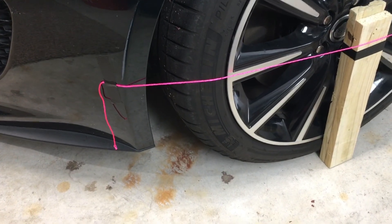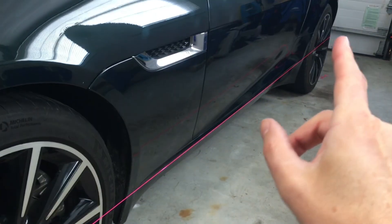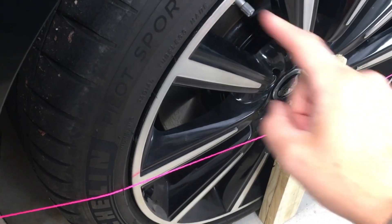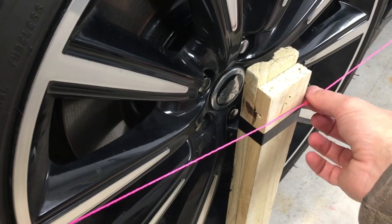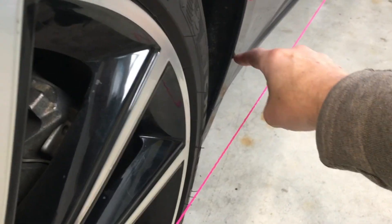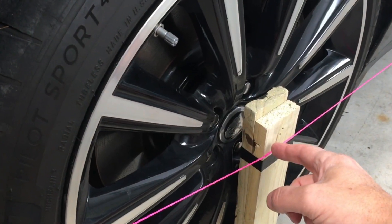This is the augmented string technique where we can determine the thrust angle of the rear axle. The front tire on my Jaguar is 35mm inboard of the rear tire, because the track in the back is 70mm wider than in the front, so I used 35mm of wood spacer per side. If this stick is standing vertically, then the string should be exactly parallel with the chassis. We can assess that by looking at the gaps, confirming it's aligned with this axle plus 35mm — the rear axle.